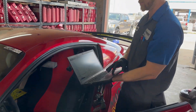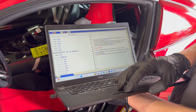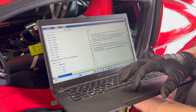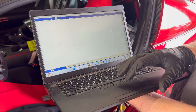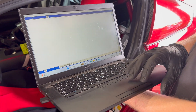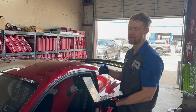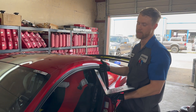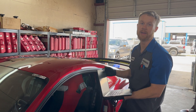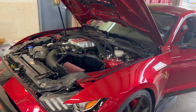No codes. So you just had to plug in and reconfigure it through the computer here? Yes. Pull out the as-built data — I pulled the data off the network and reconfigured the DPM to eliminate the brake light. Awesome. Nicely done, sir. That's it, quick and painless. Get your Shelbys done.